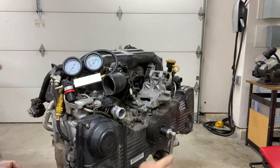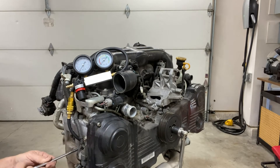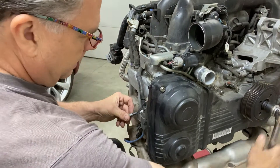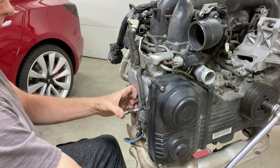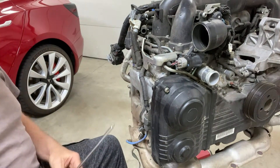We're building a little bit of pressure there. I'll take the leak-down detector off and place the rod in so it's touching the top of the piston, then keep moving until it hits top dead center. Right there — no more movement, so we're at top dead center.